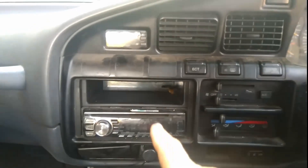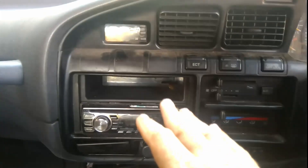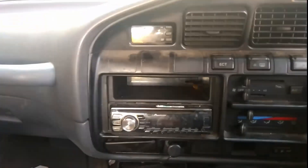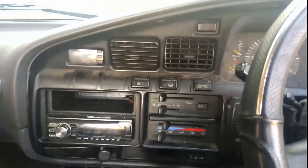If you're going to replace your head unit and you don't really want to muck around with rewiring your speaker systems, your best option is to get the adapter loom for your head unit to the factory loom. That doesn't mean you don't replace your speakers. You can see there's actually a spot to put a six-inch speaker in the door — which with the VX Sahara, instead of having speakers in the dashboard, they're in the door. So you had two six-inch in the front door, two six-inch in the back door, and the sub in the rear.